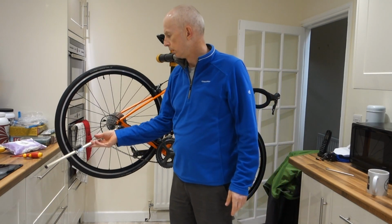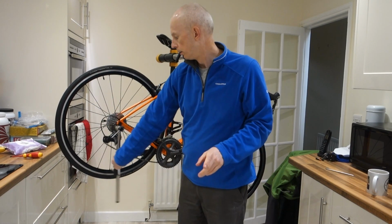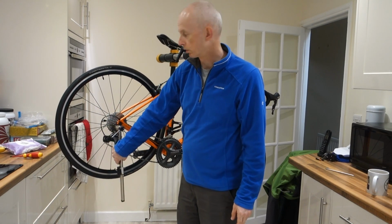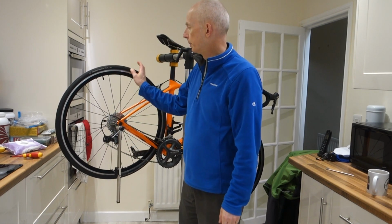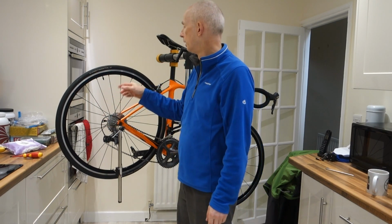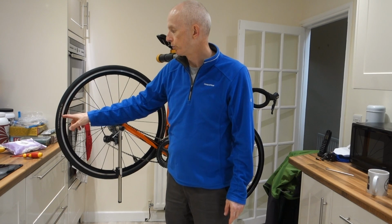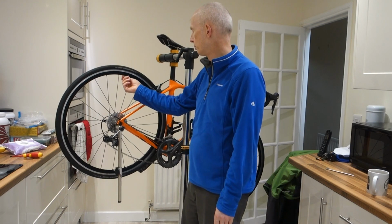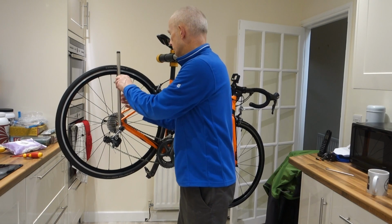So what we're going to do is check at different positions. So we're going to compare 12 o'clock and 6 o'clock, and then 9 o'clock and 3 o'clock. But because you could have a wobble on your wheel, or the dish could be wrong, to make sure that you're comparing like for like, use the same point on the rim and move the wheel. So we're going to do it where the valve is, and we're going to move the wheel each time. So let's start with 12 o'clock and 6 o'clock.